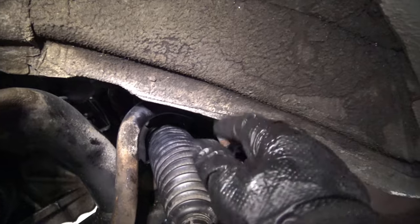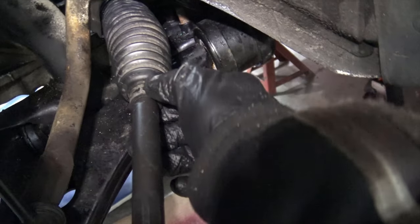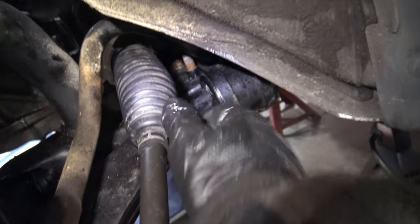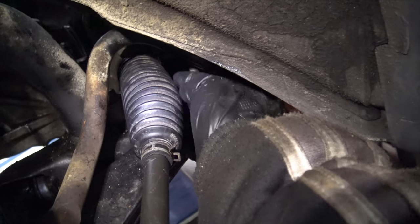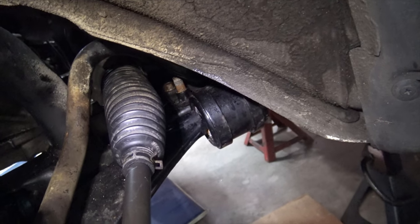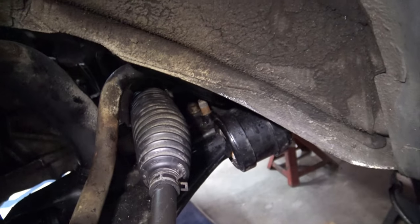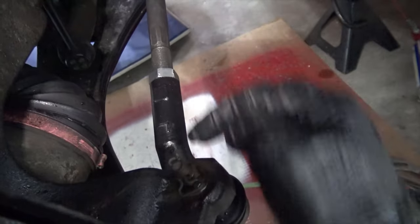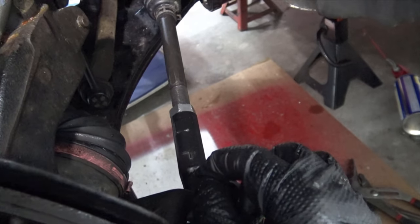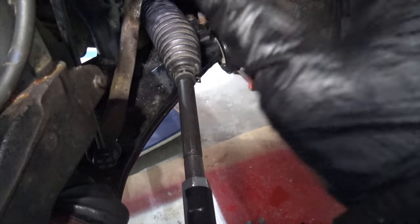I've got the bellows on — it seems to be holding in position. I've got the clamp on at the front of the bellows, everything is tightened, and that little lock washer — I bent over an edge, and that's what you do to make sure the inner tie rod end won't come off the rack. Everything appears to be tight, I'm at 14 inches, and that should allow me to drive it to the alignment shop. This job is done — inner tie rods are done.